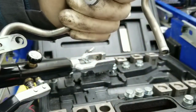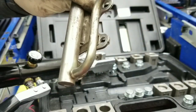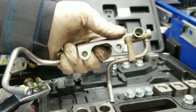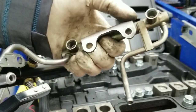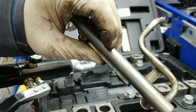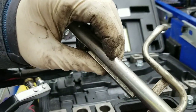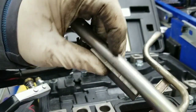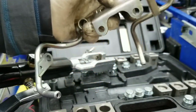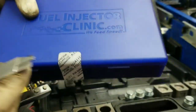I redid that side — looks a little bit better, and this side looks pretty solid as well. Looking perfect. Go ahead and put this back on the car and that fuel rail is done. It's a 500 horsepower fuel rail, don't let anybody tell you different. If you want pretty fuel rails, absolutely — if you want rails with nice pulse dampers like Radium makes, those are awesome rails. But is it a requirement? Definitely not. As long as you run them in parallel, you don't have to worry about fuel starvation on one cylinder.